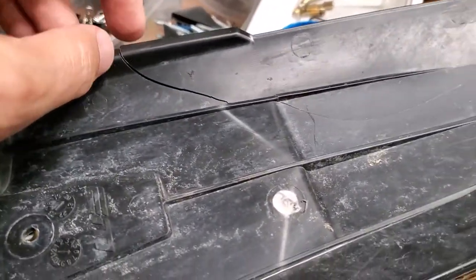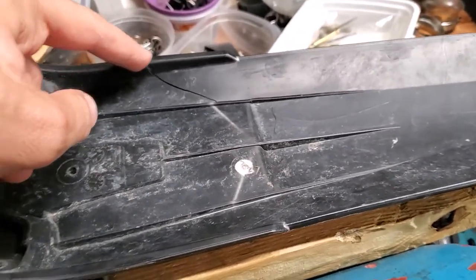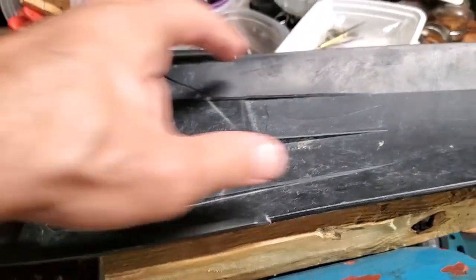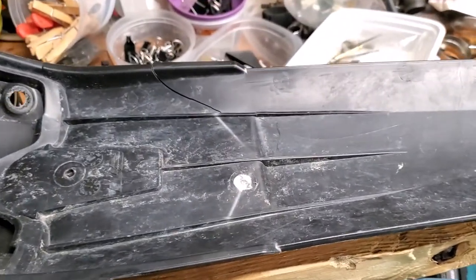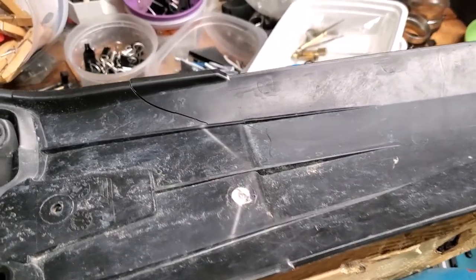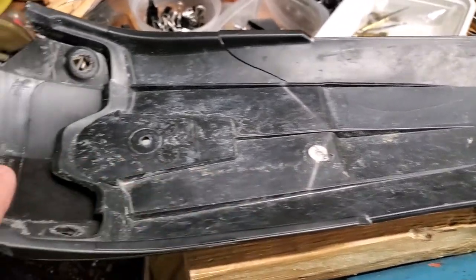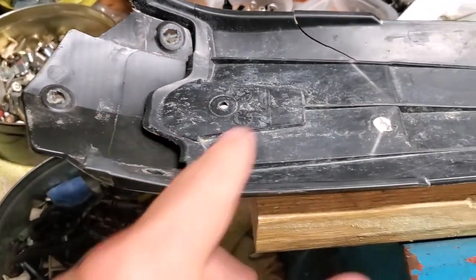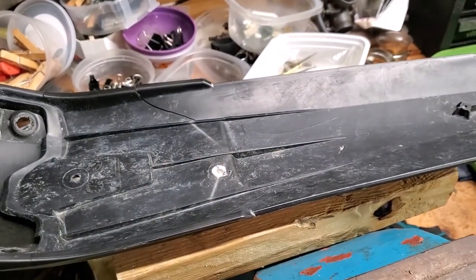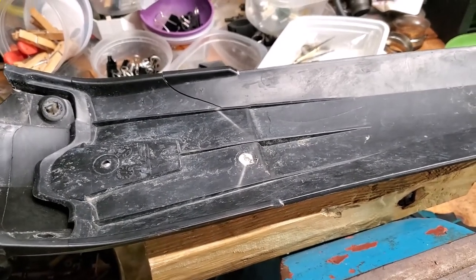The other thing is I might just reinforce it. I'm also looking at buying a Lexan sheet and just forming another fender. I might just cut this one off here in a diagonal or something and put a Lexan fender on. I might even just attach it with velcro so I can snap it off when I fall and restick it back on, because if I use the Lexan it'll transfer stress into this and maybe break it again. I want there to be a weak break point here that gives way so I can snap it back. Maybe I should put a buckle spring hinge on it — it bends back and you can just flop it back.